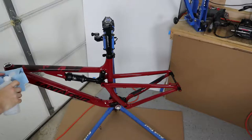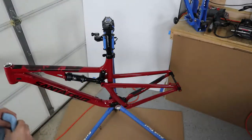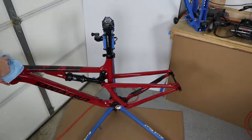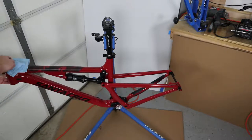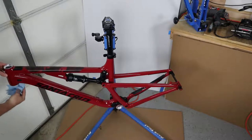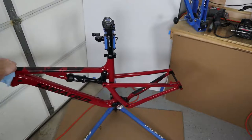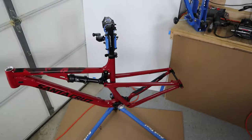The first thing I'm going to do is actually clean out the inside of the head tube. The steer tube fits up through here — this is a tapered head tube, it goes from an inch and a half to an inch and an eighth. Just give it a good wipe down, make sure there are no burrs in there. Then we'll move the frame from the stand so we can put our fork in the stand to set the crown race.